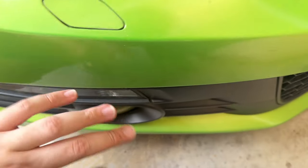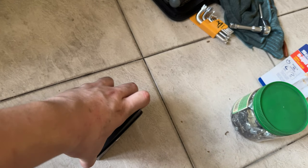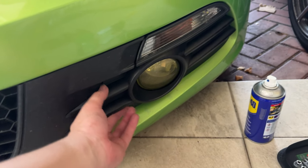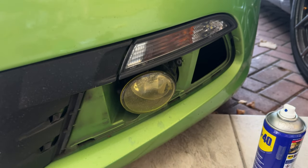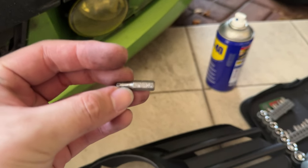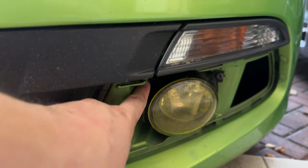So let's get everything fixed and then we will continue to replacing the fog lamp bulbs. So now we're going to work on the fog lamps. We're going to take the LED bulbs from Max GTRS right here. These, I believe, are H4 if I'm not mistaken. The process to install this is actually really easy — you just need to take this front piece off. And then three screws and then your fog lamp will come off. So to unscrew this fog lamp, you need a T25 bit. Let me just show you — T25. And then there are three screws: one, two, and three. And then you can remove the fog lamp.